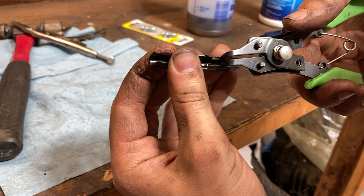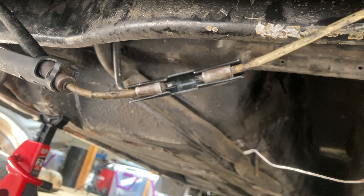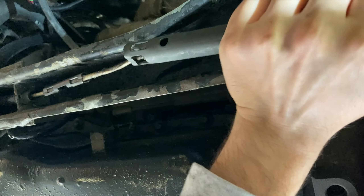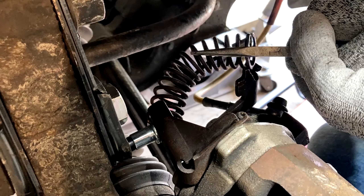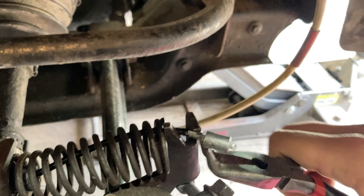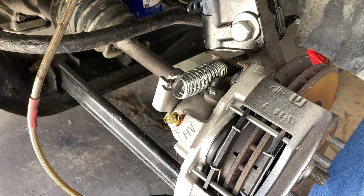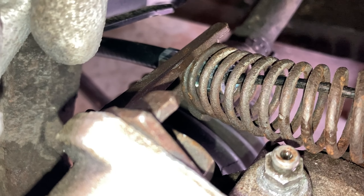If the connector is a bit tight, some snap ring pliers might be useful for loosening it up. It helped me to put vice grips on the cable and pull it through. The passenger side e-brake cable and the main handle pole cable attach together with this connector. Next, you're going to have to thread the driver's side e-brake cable end into the adjuster. In order to get enough slack, go ahead and pull on both sides of the cable to see if you can get the adjuster in the place you need it to be. Once you have at least five or six threads on, go ahead and pull the ferrule end back into place. Now is the fun part where we get to wiggle the spring on and reattach the emergency brake cable. Even if you're not hooking up your parking brake, these springs must be installed to ensure proper operation of your calipers. Make sure the cable is pulled all the way out as far as it will go. Put the spring around the emergency brake cable, then grab the cable through the spring with the pliers and thread it into place on the lever. Take some pliers and bend the snot out of the spring then locate the spring over the lever. Take some vice grips, grab the lever and compress it back a little bit. Grab some more pliers and pull the cable into place. Make sure that the spring is seated between these two clips on the bracket and going over this nub on the lever.